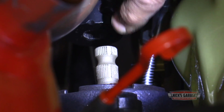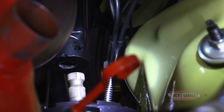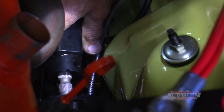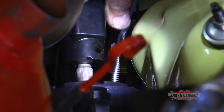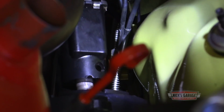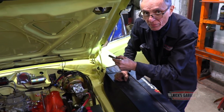Okay, so we've got the coupler and the steering box, and it's got a spline. So this has to line up for it to go in place, like so. Watch this. Hold on, Manny. Okay, push it in. Keep coming, there you go. And after that, we put the lock pin, and it's in place. So now we'll continue installing the inside.